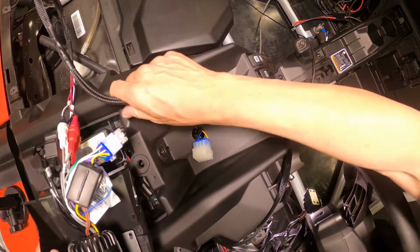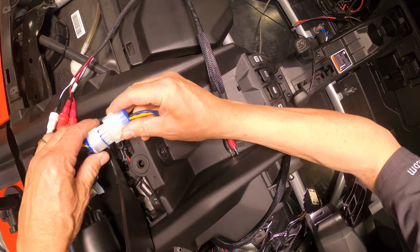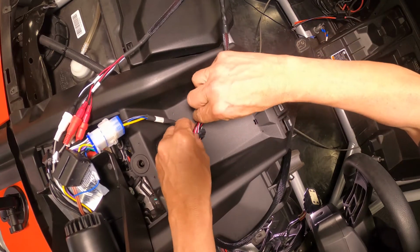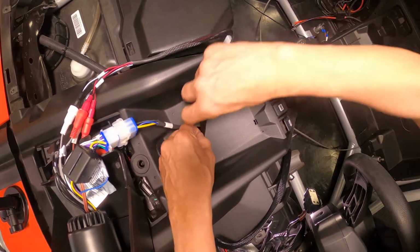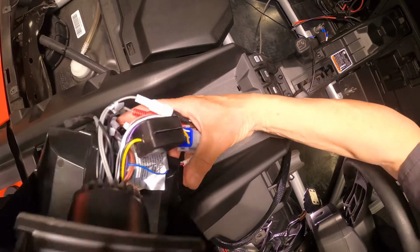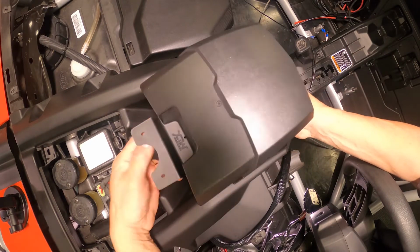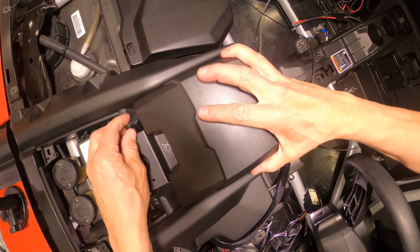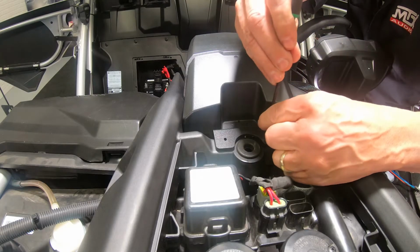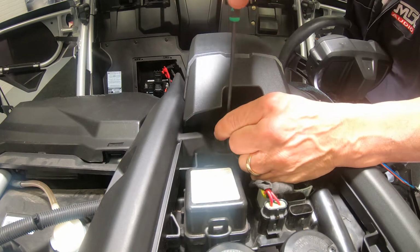Now that you've got your holes drilled, we need to make our radio connections and feed our signal cable, starting with the black end first and the RCA down through the hole you previously had drilled. These need to get routed to the amplifier area. Seat the radio into position, align your holes, and tighten down the 4 screws, 2 in the front and 2 in the back. Before you tighten the screws down, make sure all your cables and wires are tucked neatly inside the shroud.